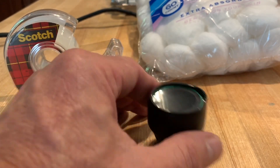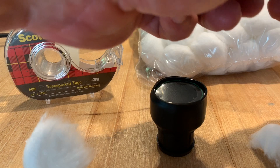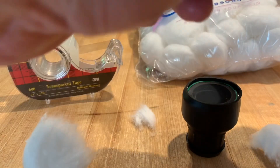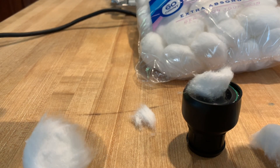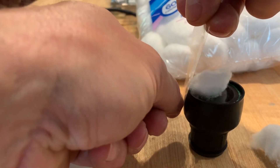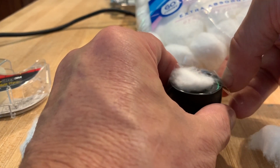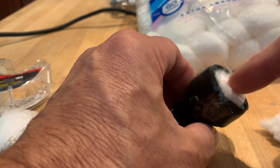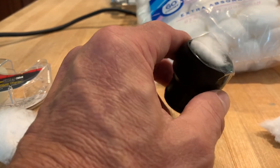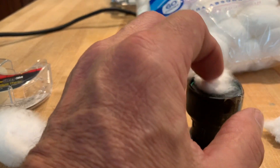The second way you can stop this vibration is by just taking a cotton ball — simply taking a small piece off like this. You don't need much. Basically, what you're trying to do is create a little bit of resistance on the membrane to keep it from flexing and vibrating. Scotch tape works really good, and you just simply tape it on — it doesn't have to be tight at all. Slightly loose is good, just putting a little bit of pressure to stop the vibration. That's enough to stop it from causing this vibration, which can sound like a rattle. Not many cars have this problem at all — it happens every once in a while, and this is a really easy way to fix it.